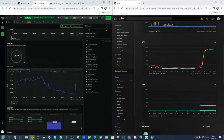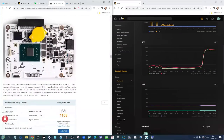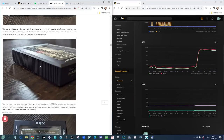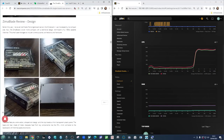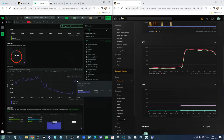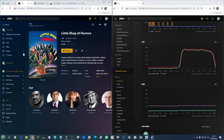At the same time, the CPU temperature has increased quite rapidly. I talked about this in my review: the CPU is on the base of this system, covered by a heat sink that makes up the entire base panel. With no active cooling, and running this system live on a table, if you've got it in a closed system that temperature — while not a throttling temperature — is worthy of considering whether you should look into some active cooling for this in a smaller casing.